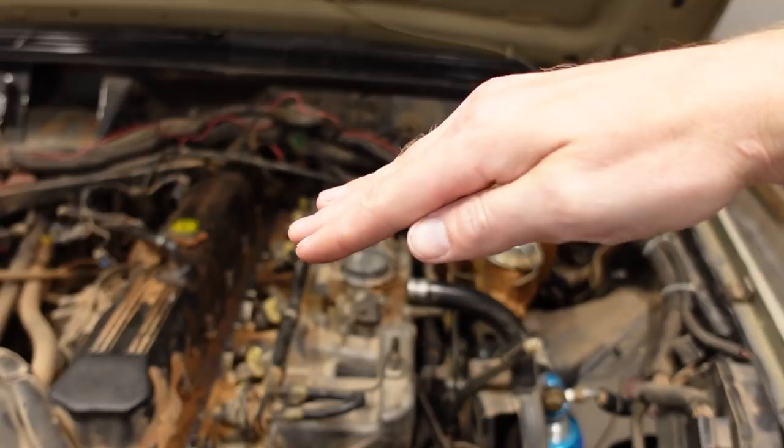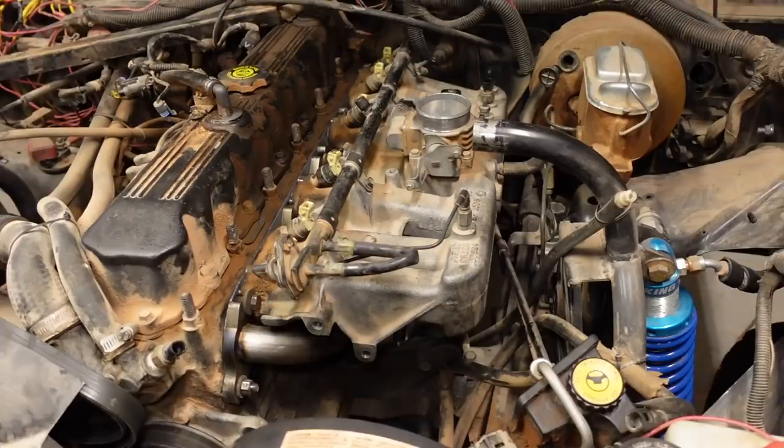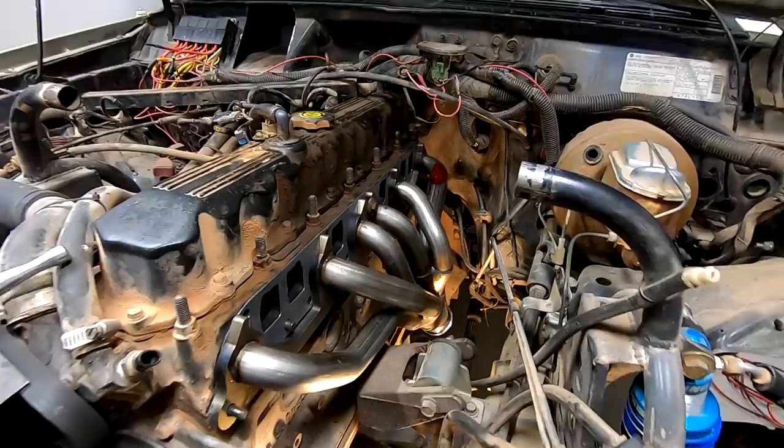So I was trying to figure out what was going on there. At first, I thought maybe the shape of the flange was not allowing the intake manifold to sit onto the dowel pins, but it wasn't that. It was actually primary number 6. Now, I had to actually get the hammer out, which I hate, pounding on headers and stuff, but there's really no other way around it. I had to dent in the tube, which, whether or not we like to admit, is kind of standard stuff when it comes to fitting headers. So, primary number 6, right where it exited the cylinder.